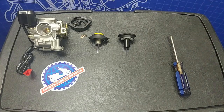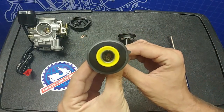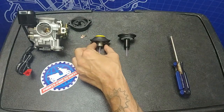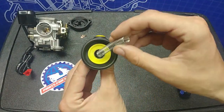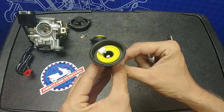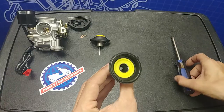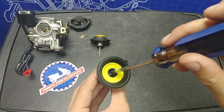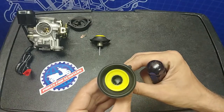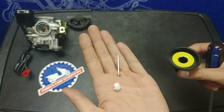The needles are held in differently between the different model carburetors, like the 20 millimeter stock carburetor or the blacktop carburetor. As an example, this one is held in with a little screw and plate, while others can be held in merely by the tension of the spring holding a little white piece down that forces onto the needle. Then other models will have a white piece with a Phillips slot — you stick the Phillips down in there, do a third turn, and it releases the white clip. Then you can simply dump the needle and retainer into your hand.